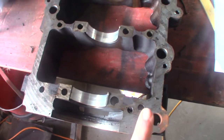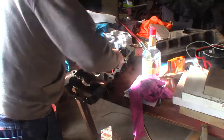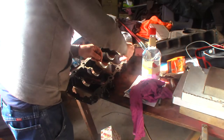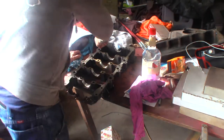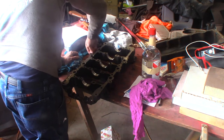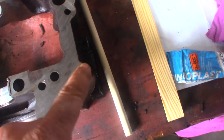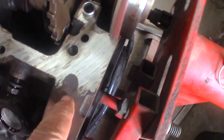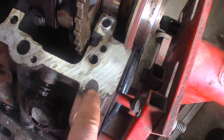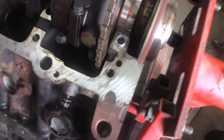This is what I'm going to clean up over here — the bed plate. I keep wanting to call it a bed pan, but it's a bed plate. Looking at this, there's a raised area that matches over here — this is where it came from. Probably when it was originally made, the sealer didn't go around here, so moisture got in there and rusted between the two layers. I'm going to have to sand that off, or it won't lay flat.